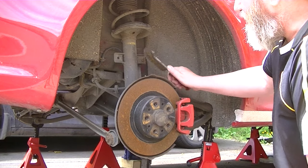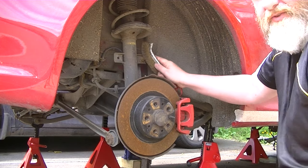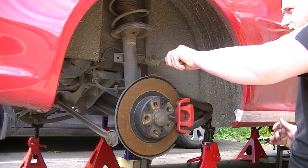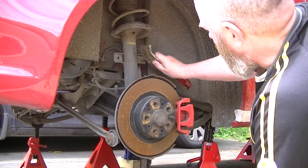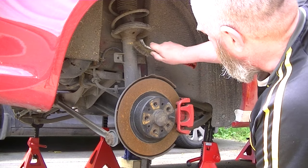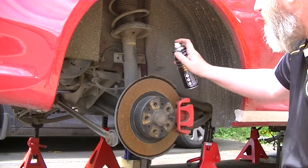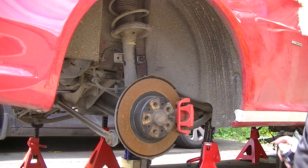This is the drop link — we're going to get around that. These things rust solid and can be an absolute nightmare to remove. So we're going to get in there and remove the crud as much as possible, then put in a little bit of Plus Gas and give it a good soak, front and back.